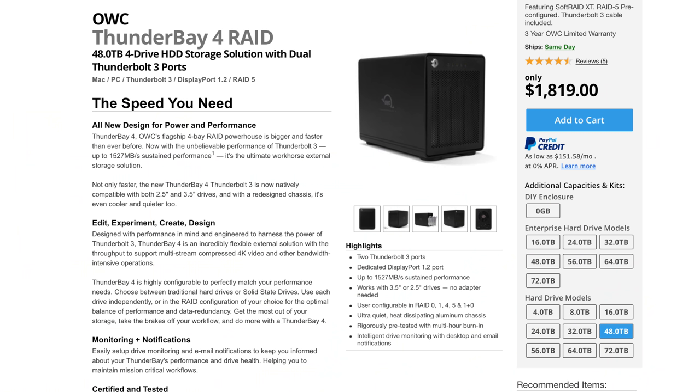What I did add this time was a 48TB RAID array from OWC. This is a huge upgrade over what I'd been using previously, which was basically just a bunch of external hard drives over USB-C that I bought every time they filled up — I've got like three or four of them. I probably should have upgraded to a RAID array sooner. It was about $1,800 to $1,900 for this 48TB configuration. The 48TB version from OWC comes with SoftRAID configuration software, so it was super easy to set up. It's almost at gigabyte read-write speeds, which is much better than the external drives I was using before — those were like 50 to 100 megabytes per second. It was just awful.